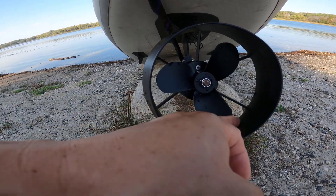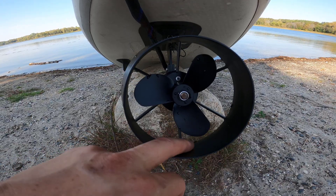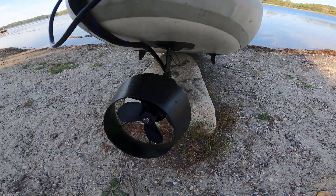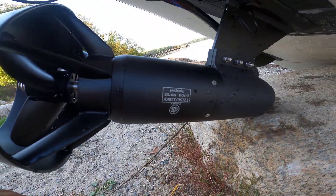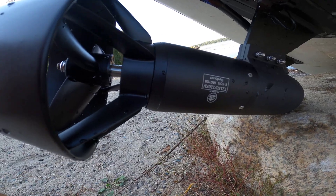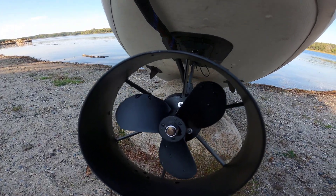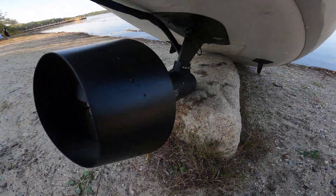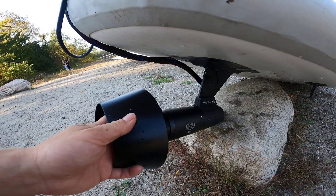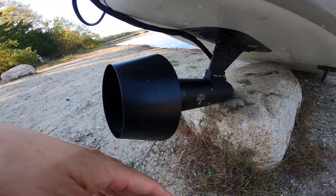They simply put a propeller that is too small. This motor supports a much stronger setup — it's a 72 by 150, 120kV motor, which supports really strong performance. But they only put a very small propeller here. They definitely won't get any speed even if I put a 10S battery. They say the top is 12S, and 10S versus 12S is very little difference. So this is just a wrong design.